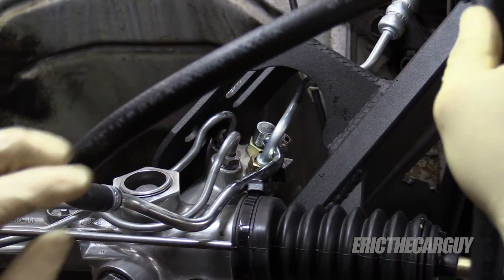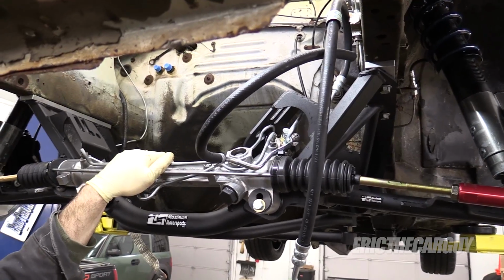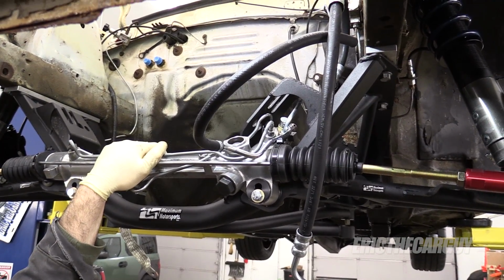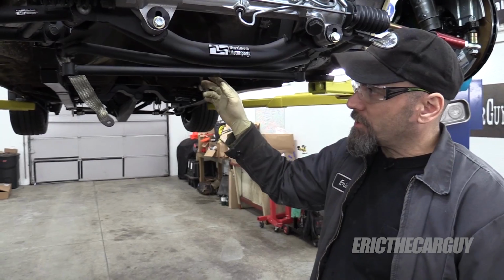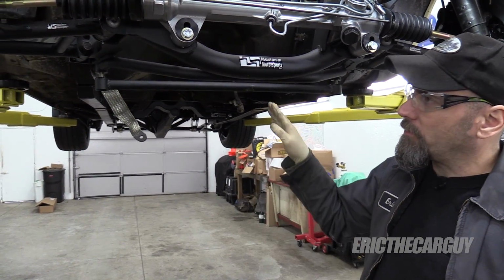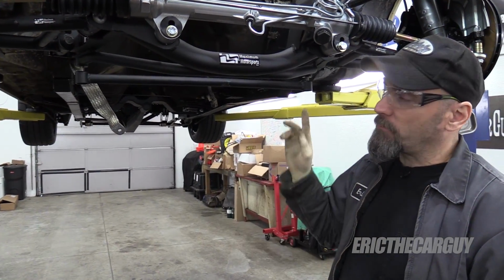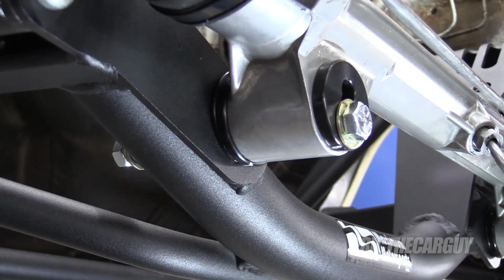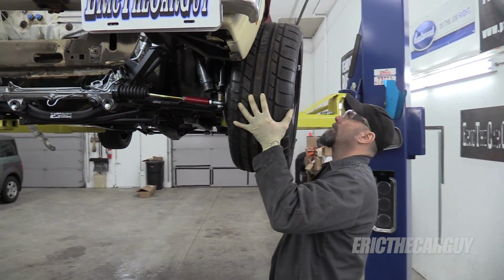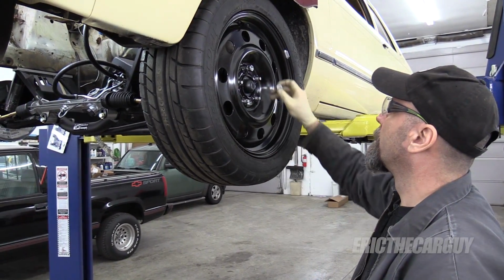At least now, we know where our hydraulic lines will be going. And I can check for interference with the engine and everything else when I drop it back down in to make sure that all the lines clear. Just to keep all the parts together, I've taken this brace and just loosely threaded it up into place. I need to remove this before installing the engine again, but for now, I know where it is and where the fasteners are. Now that the suspension and the rack and everything is in place, I'm going to bolt the wheels on just to check clearance with everything. And also so I can roll around the shop again.